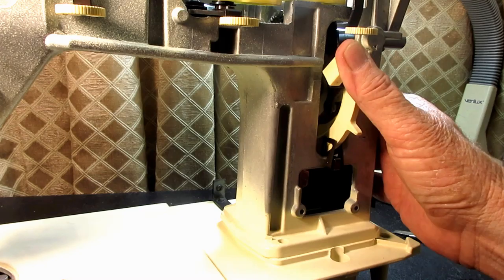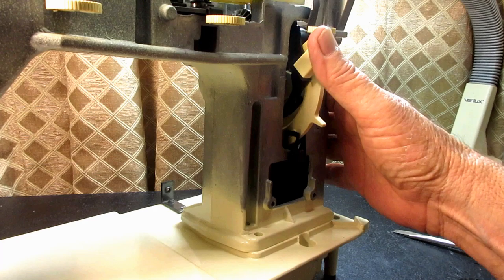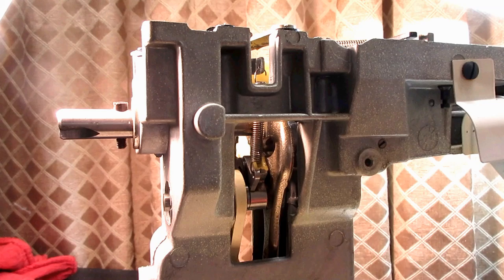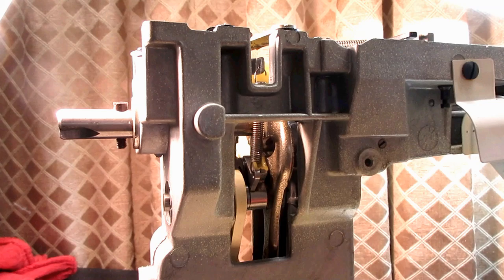When I cleaned it, I noticed it's a little easier to move but still very firm. So I'm figuring something is binding. I got it all clean and oiled, so it's not that — but is something out of adjustment? I don't think so because when I look up above and down below at that forked feed connection, it all looks correct. That forked feed connection comes down here; here's that shaft coming down, and here's the rocker that goes to the feed bar where the feed dog is screwed in right above.